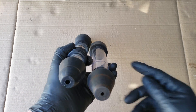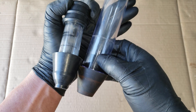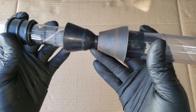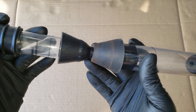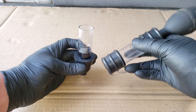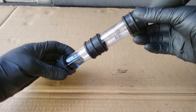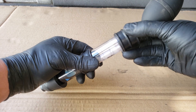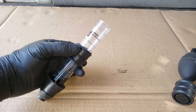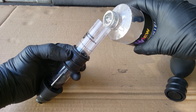For this Honda, I had to purchase this dual-chambered unit due to the fact that my original one wouldn't fit on the radiator, yet this newer dual-chambered unit has a smaller end and does fit perfectly. The main difference being that this dual-chambered unit is supposed to be more accurate, as the lower chamber will filter out any particles that may create a false positive result. On this one, we will fill both chambers up to the specified level, while on the single-chambered block tester, we'll only have to fill one chamber to the fill line.